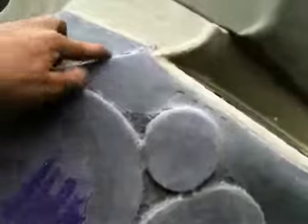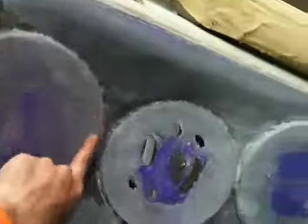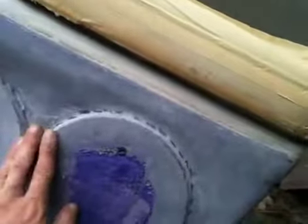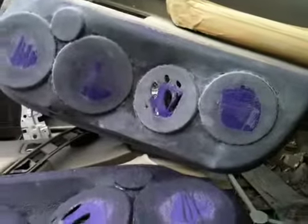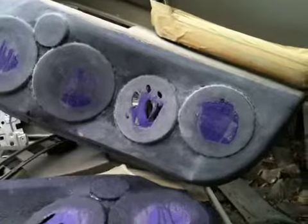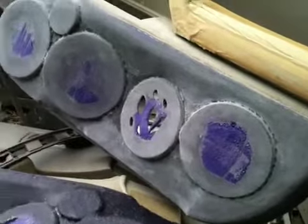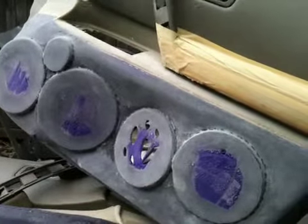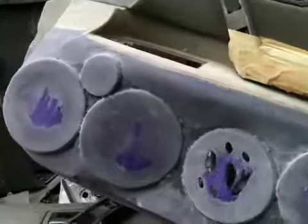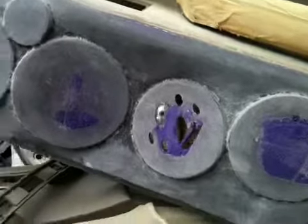Like I said, once I come and I fill in these staple impressions, all these edges with Bondo, it's small stuff, man. Clean that up. What I do is I have a special solution. A couple ways to go about it. I don't want to give out my secret, but to you guys, one thing you might want to look into is, what's that stuff called? It's an additive for the polyester resin. It's a powder. It's a very fine silica. That's what it's called. It's silica.